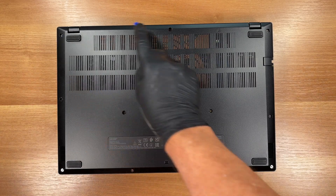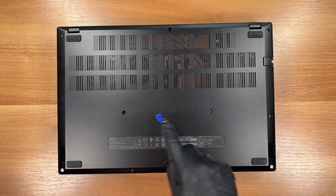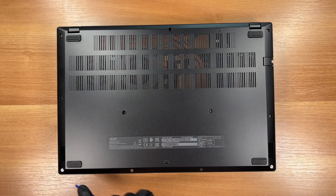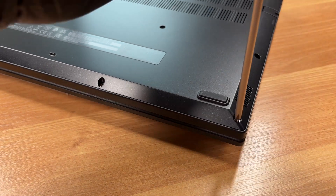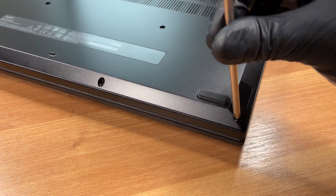To access the hardware, remove 11 screws, then we'll be able to lift off the bottom panel. Use a JIS number 1 screwdriver for a snug fit. Philips type could do the work as well.